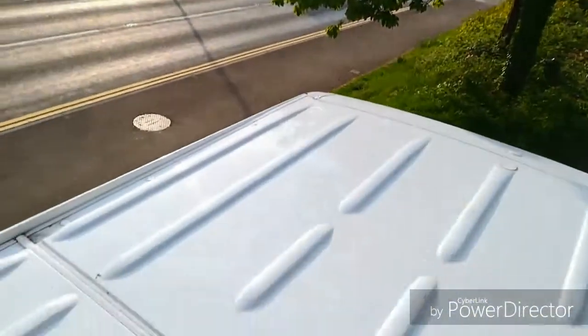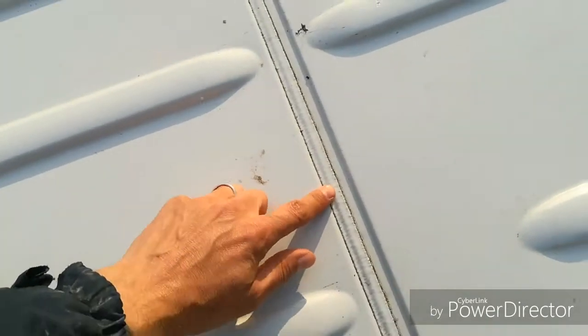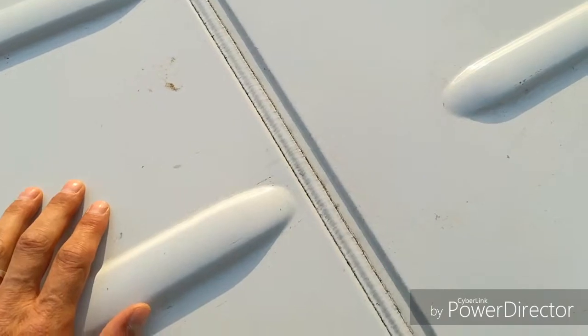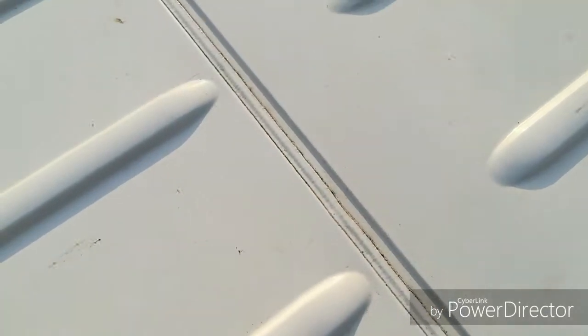On a lot of sprinters that we went to have a look at, inside the roof we noticed there was a lot of rust along the seam. So what I'm going to do now is seal that seam up — whether it's right or wrong, I don't know. But anyway, you can't do no harm.